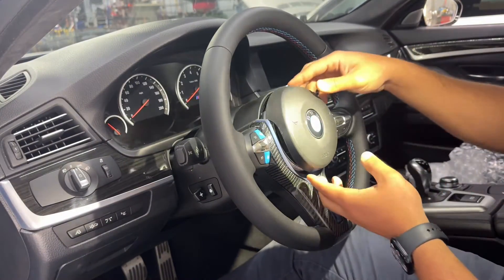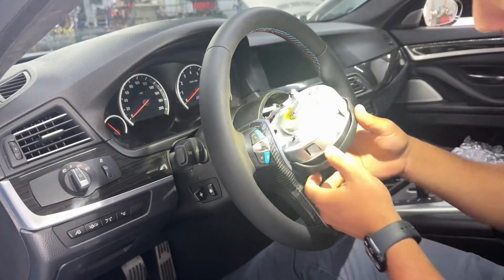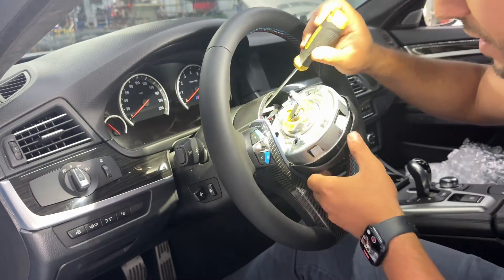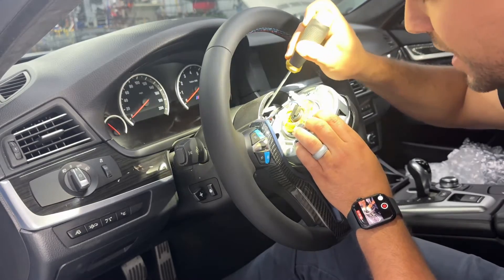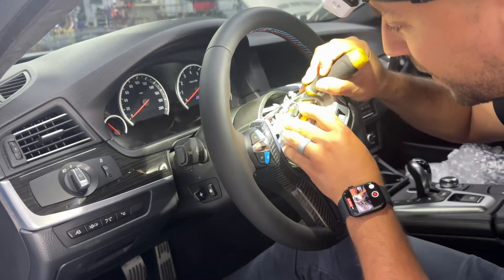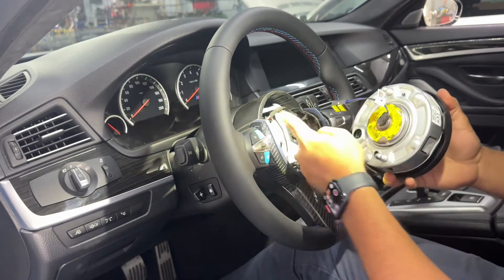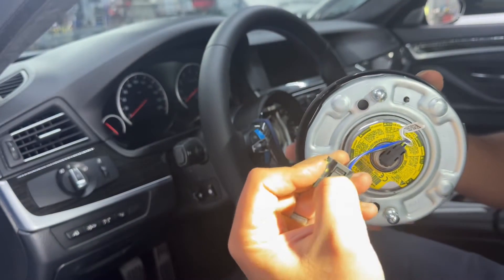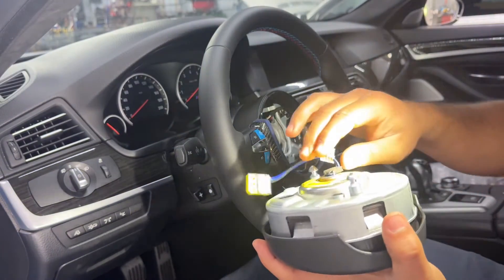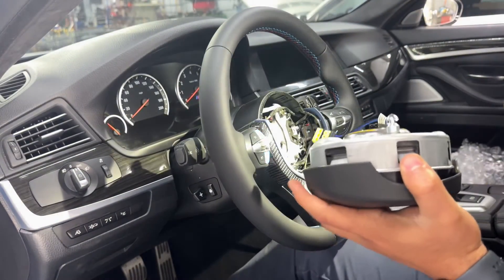With the steering airbag off, I'll pull it out and show you — it has only one connector right there. I'm going to disconnect it from the inside using a flathead to push on the tab that hooks up to the clock spring. That's the tab right there on the connector — you push on that tab and then the connector comes off. To remove the connector itself you simply pull on it or use a flathead.